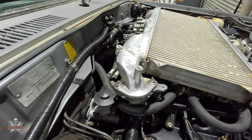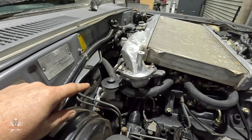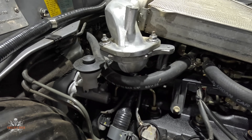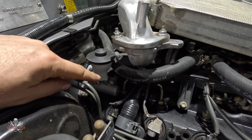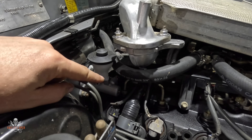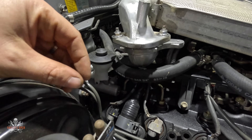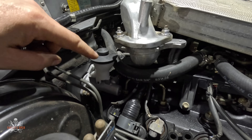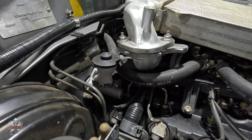There's really not much clearance with anything — we're talking tight tolerances with everything. What I've done is made up a custom clutch line with a banjo bolt here, so we're basically minimising the amount of stick-out, and then that just runs down to the slave cylinder.